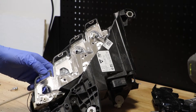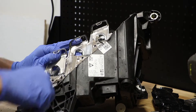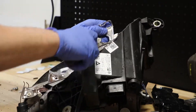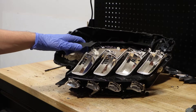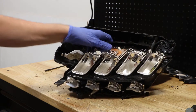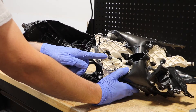Next I will use a flathead screwdriver to pry out these trim pieces. Then I will remove the T20 screws holding on the metal bracket behind the LED reflectors. This assembly was held onto the back of the housing through three mounting points — there was one major one here, and the lower mounting points are the headlight level adjusters.